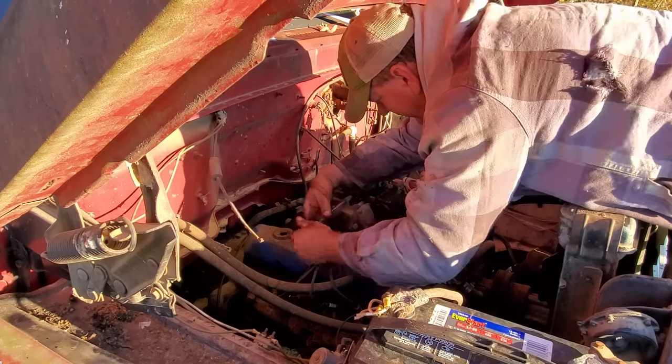Well, I pulled the old gas tank out, and the leak is back here on the back side on the bottom somewhere. I just see fluid coming out. I don't know where exactly. I think it's right in that area. The old tank is extremely, extremely rusty on the inside. I can't find an F600 tank, but it looks very, very similar to the gas tank in Dumas. So I'm going to take it home, and we're going to measure the bolt holes and length and all that. If it looks like an F100 tank will fit, then that may be what we do, just get a new tank.